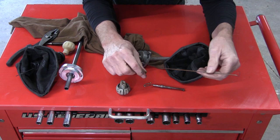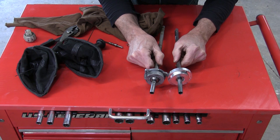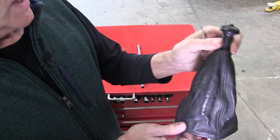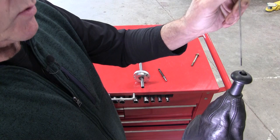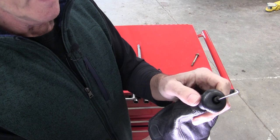You're going to need to bring these pieces over to the new shift assembly. Here is the new assembly side by side with the old, and you may notice the new one is slightly longer — that is important, that's going to make the difference in your shift movement. So let's continue with assembly. Here is our gator and the threaded rod we removed. The rod goes right into the top of the gator and you'll notice there is just a little L-bend, a 90-degree bend, that fits into the slot.